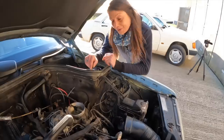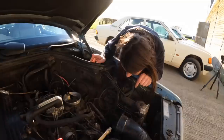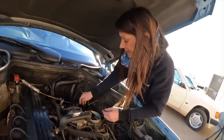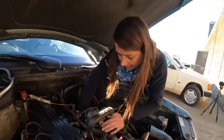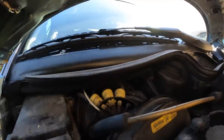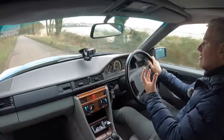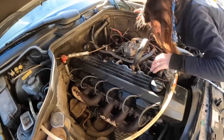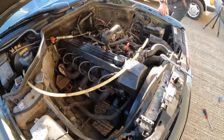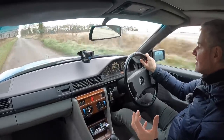While I was there she had a quick look over the car about this low rev hesitancy, because I thought it might have been ignition related. Jasmine didn't think so — she thought it was more likely to be a vacuum leak, and she had a quick scout around the engine bay and did find one vacuum leak. It hasn't made a huge difference but there is a possibility of a vacuum leak underneath the injection assembly — the mechanical injection — with some pipes under there that you can only get to from underneath the car.